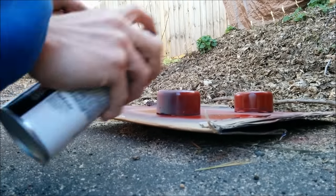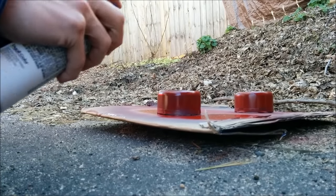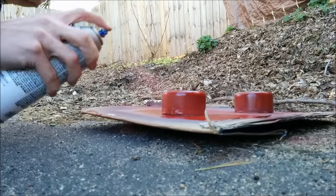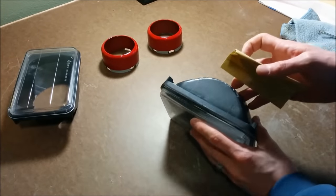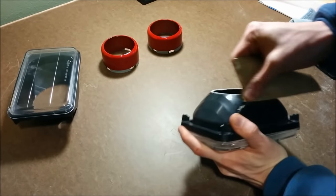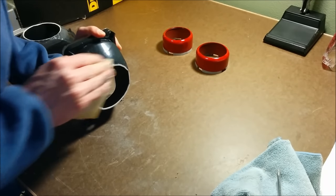So I used three coats of primer and three coats of top coat, all high-temp rated for over 500 degrees. I also taped off the lower half inch of the shrouds so that the paint wouldn't get on there — that would be where the glue would stick. I didn't want the glue sticking over the paint.